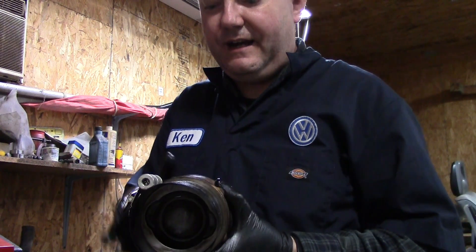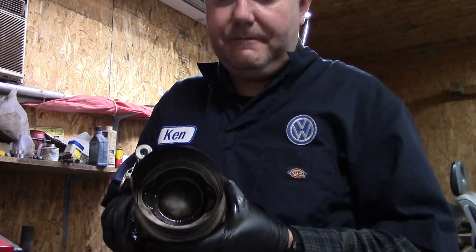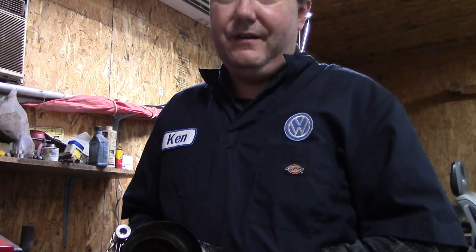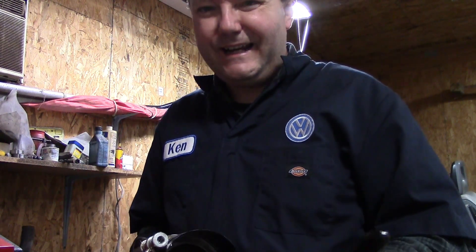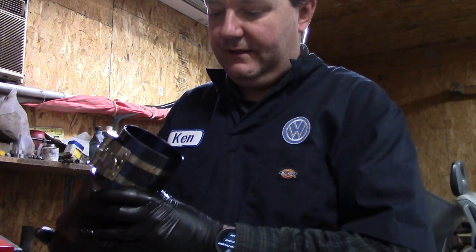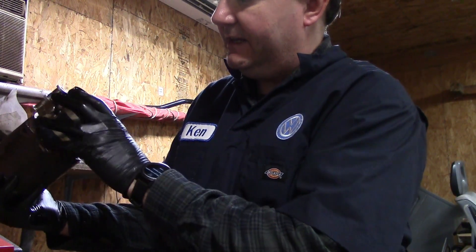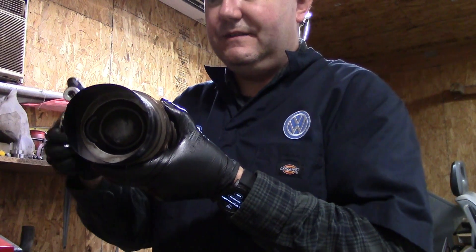It's going to the center. Because this is cylinder number one, this is going to be towards the rear of the engine. You can turn this once it's in here, but we showed you last time how to position your rings. You really don't want to have to reposition it — you want it to just go together and be done. I've got it in here with these two things basically facing side to side, aligned with this flat piece.